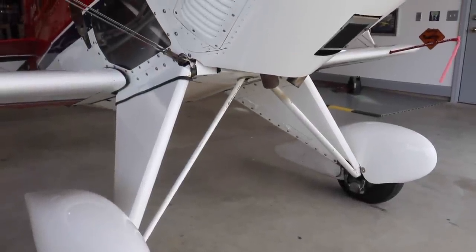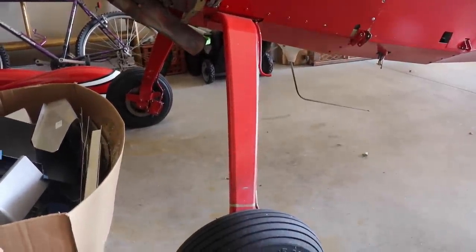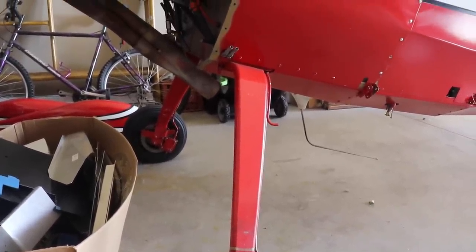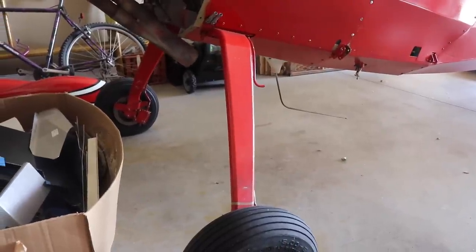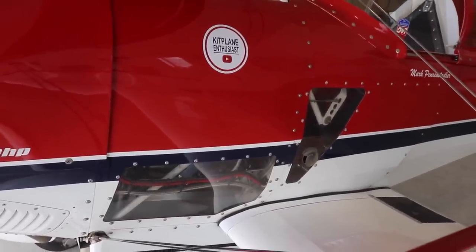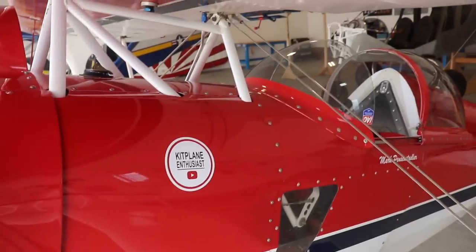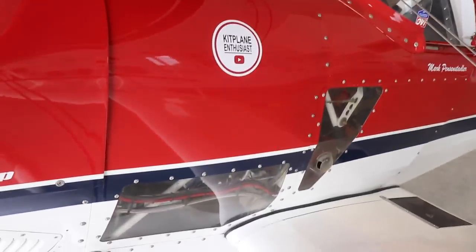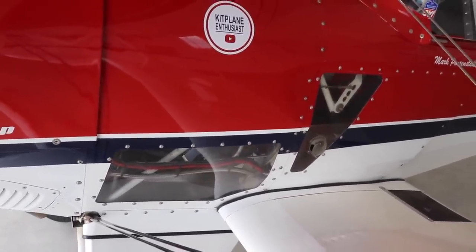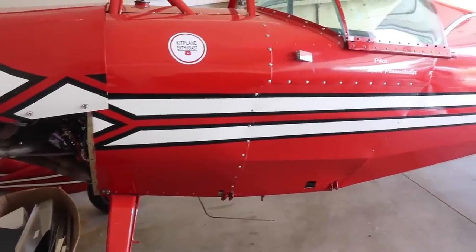This airplane has bungee-style landing gear, while my E-model has spring steel gear. I don't know which is better for flying, but with the spring steel gear you don't have bungees to replace — it's more maintenance-free. Another difference on the D-model versus the E-model is that I have two side windows. I'm told they're more useful in the aerobatic box, but with my limited experience I don't really use them, though they're nice to have. The E-model has no side windows.